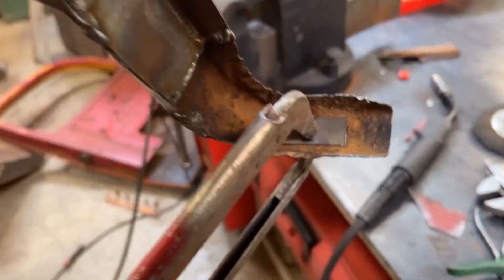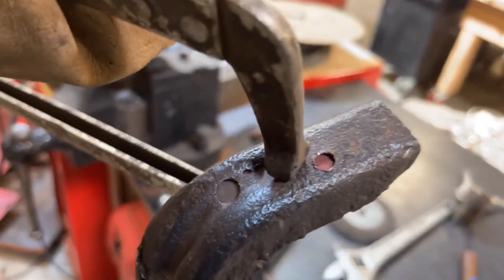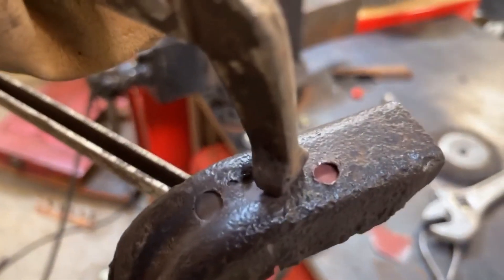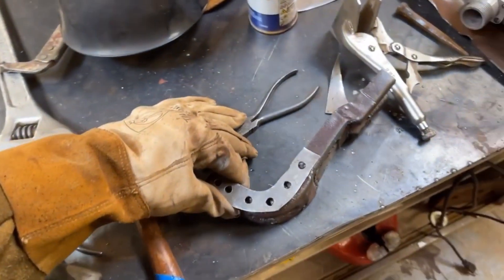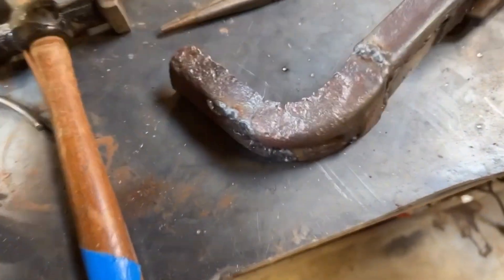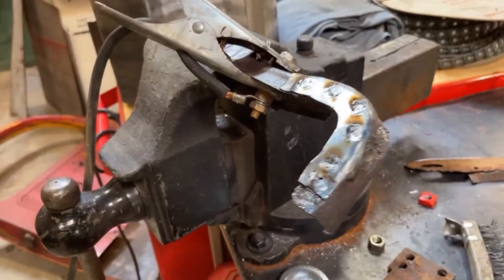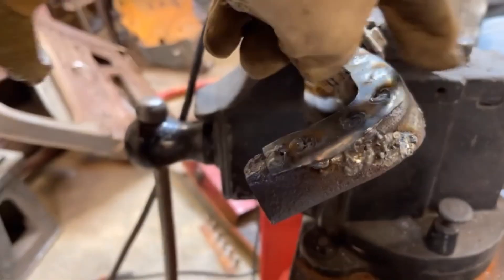To tackle these holes — some quick setup notes, since this whole thing is like the completely wrong way to do this. I'm just taking a piece of steel, clamping it in with this giant clamp that I love. You can see the holes where they exist. I open them up with needle nose pliers to expand the hole to solid metal, and I'm just going to plug weld those. Here's that flange support, drilled on the drill press off camera — it's going to be plug welded and then edge welded across that flange to beef up what little metal exists. Plug welds are in, I've rounded the edge over with a hammer and dolly, and I'm going to edge weld the whole thing.